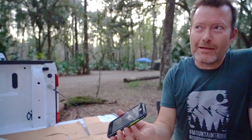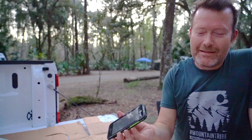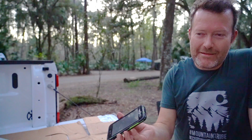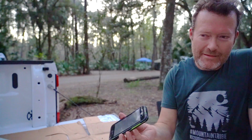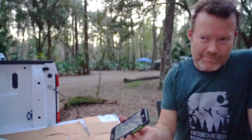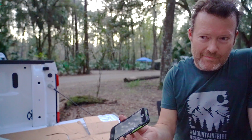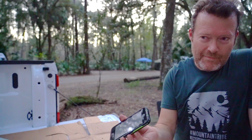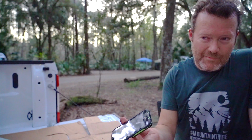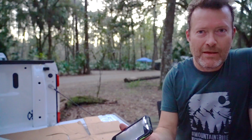Wow. So, tug tests, it's a great test because it does verify that your truck is connected. A way some people will do a tug test is instead of using the landing gear by itself, they'll fully initiate their trailer brakes with the landing gear down. So at least the trailer is stopping itself, and then they'll pull against it. That way, your trailer is the fixed item to the ground. And I'm not sure if that's how you did it when you did your tug test.